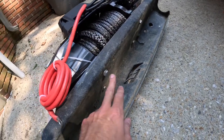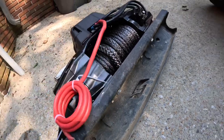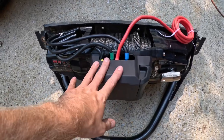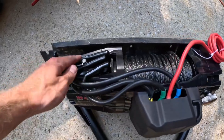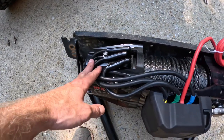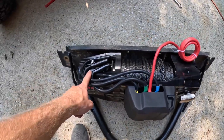After our little snag, we managed to get the Warn on. We actually ended up having to ditch a couple of the washers because the bolts running through the bottom of the Motobilt are barely long enough to catch the winch and secure it to the bumper when everything's on. We're about to hook up the negative lead here. My winch when I bought it I had to install the solenoid box and hook all this up myself, but his already came assembled. You've got your positive coming out which just hooks up as-is, and he should have a negative lead in the box that you run to the negative on the battery.